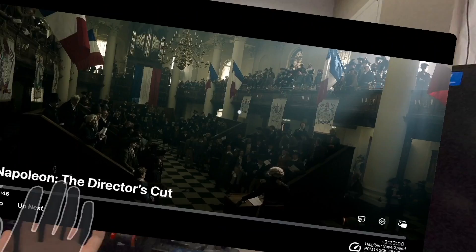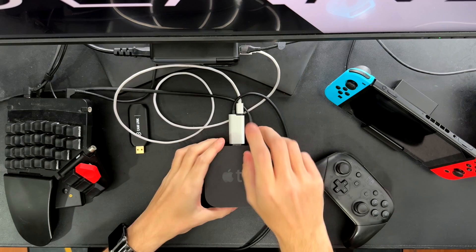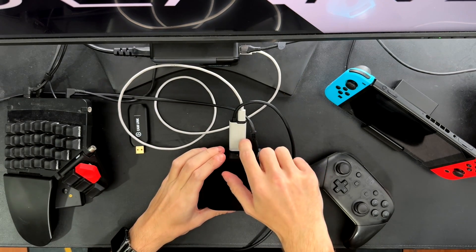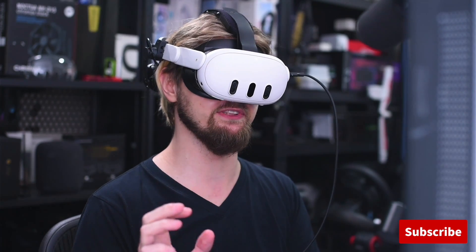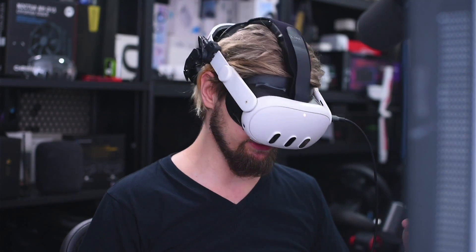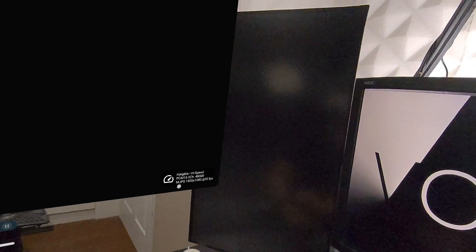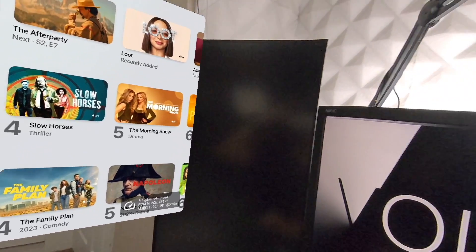It works like x-ray glasses or something. This cable has a built-in HDMI capture card — the capture card is inside here — and it's a really good capture card. You get maximum quality Quest can use: 60 frames per second in YUV 2. It has the same issue as a normal Hagibis card though: if you connect it upside down, it will work as USB 2 and use a different format — not 60 fps anymore, and not YUV. So I just mark it so I always know how to connect it correctly.